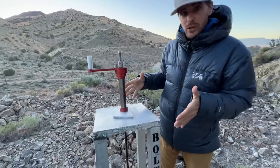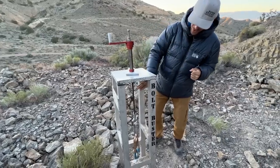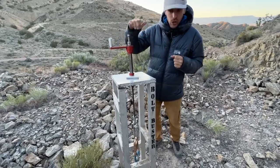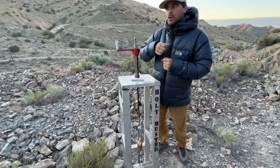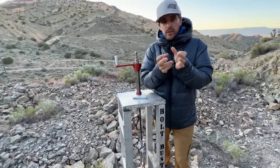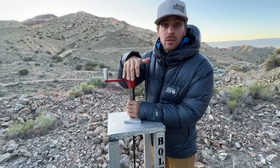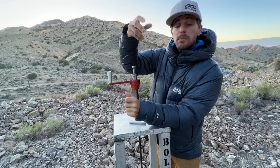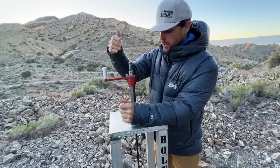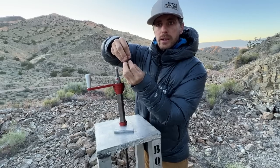We have our bolt buster table here. I installed a bolt in the ground and put this on top — got a washer, an all-thread, a funky hanger, and a line scale to measure how much force this generates. It's really important to score the wedge, the cone, and the sleeve at the bottom of the hole before you try to pull it up, because this is going to generate maybe 15 or 20 kilonewtons. With three-eighths bolts especially, you end up stretching the bolt so much that you snap the head off, leaving the stud inside the hole, and you can't reuse the hole.